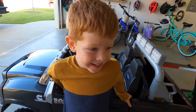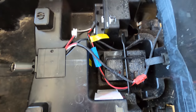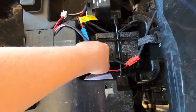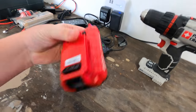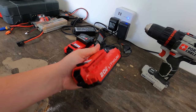First things first, we've got to get down into the existing battery. Once we got the seats out you can see down into the battery compartment. I'm going to take this cross member off that's holding the battery in place. Keep in mind these 12-volt batteries are like an additional 10 pounds — by simply taking out that lead acid 12-volt battery you get rid of about 10 pounds, and we replace it with this lithium-ion battery that is literally just a couple of ounces.